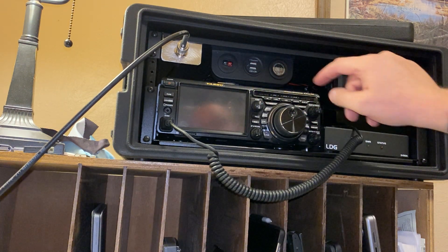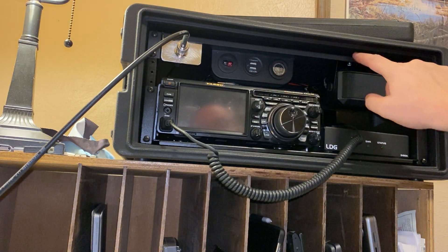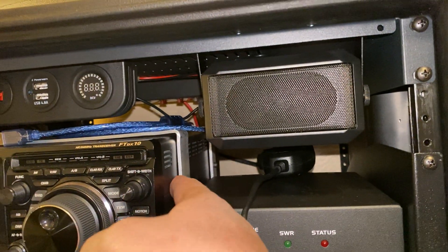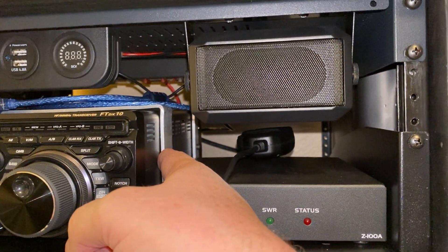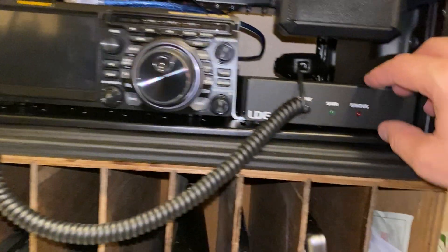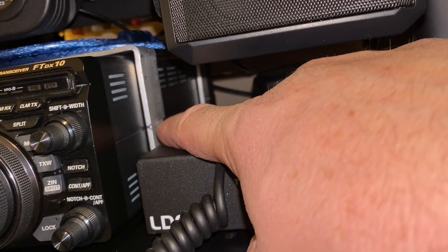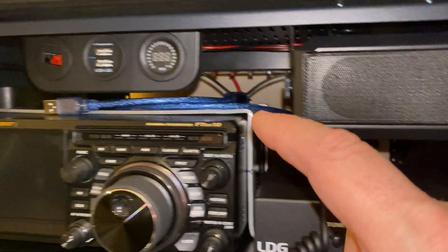Most of the time you're just finding somewhere to drill a hole. There's a screw on either side, and some attachment points are adjustable, some are not. For the radio, I opted to build straps out of aluminum flat bar — it's an eighth-inch thick, one-inch wide. It starts over here, comes up and over, with a little leg that screws into the shelf on the bottom, using the holes on either side where the handles go — so it's a structural hole.